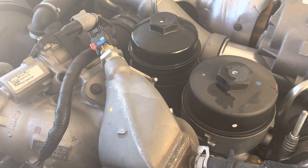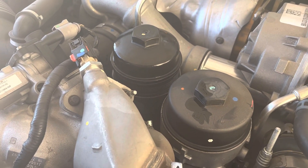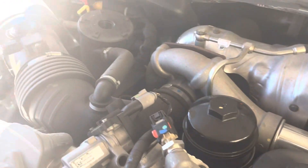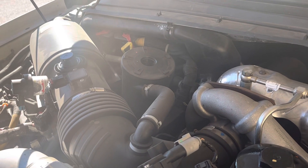And then after that, you just go down, pull the drain plug with the 19 millimeter wrench, replace that copper gasket to make sure it doesn't leak next time, and fill her up right there with 15 quarts of oil.